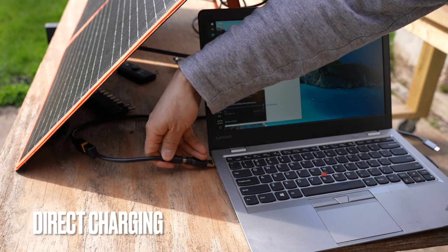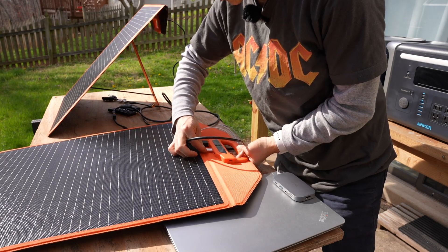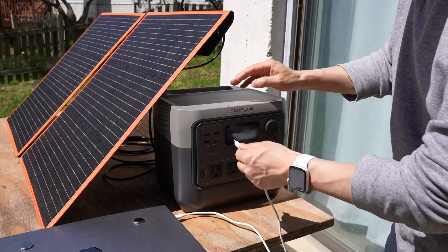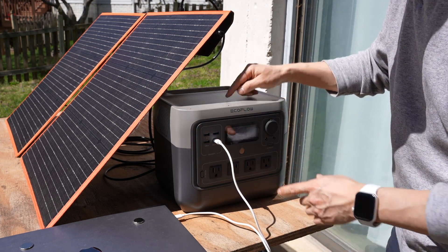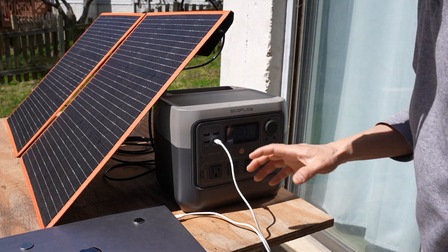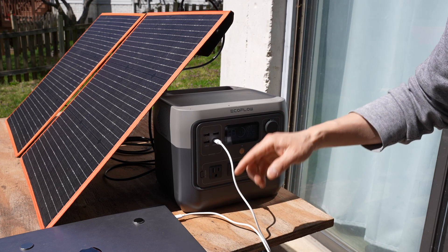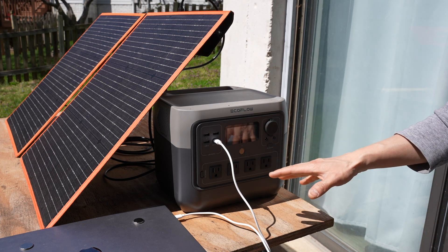By using this adapter I can directly charge my laptop — this is a Lenovo. To charge the iPhone I'm using a USB Type-C to Lightning cord. The best way to charge a laptop like a MacBook Pro is via the USB-C output from the power station, instead of connecting directly to the solar panel, which can be unstable if there's an overcast. The EcoFlow River 2 Pro is acting as a buffer, outputting 60 watts to the MacBook Pro while getting 73 watts from the solar panel, which greatly offsets the power consumption.